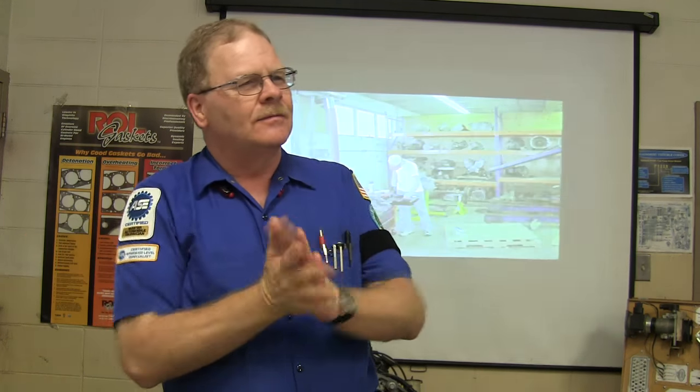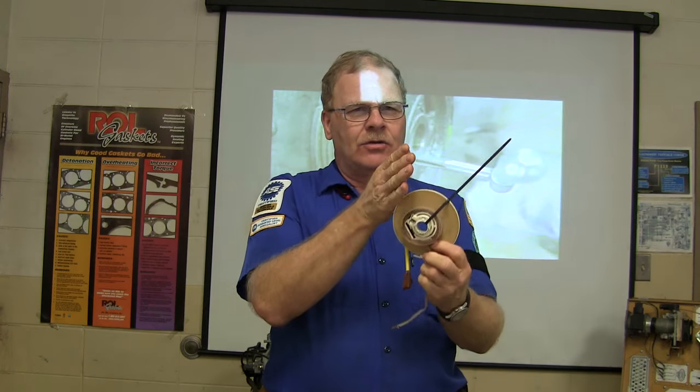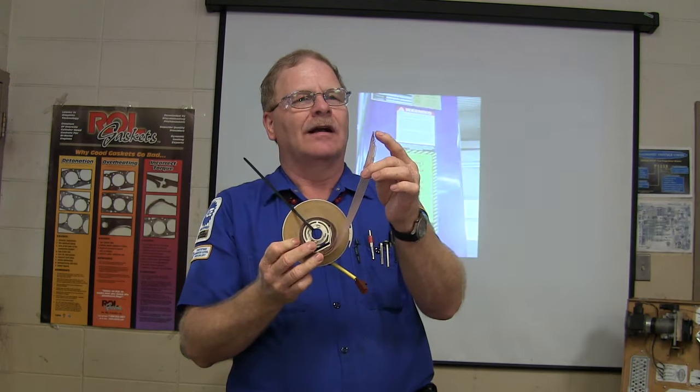Let's say you bring your vehicle in, maybe your own vehicle, and the rack and pinion is leaking. So you pull the rack and pinion off, and in the midst of all this, somehow or another, when you put it back on, the rack's all the way to one side or the other, or maybe the steering wheel's turned this way or another. Maybe you have to turn the wheels. When you put it back on, the rack is in the center, but the wheels return. That means the clock spring is wound all the way up, just as tight as you can wind it. But you've got to be able to turn the wheel both ways an equal number of turns, like 2 3/4 turns each way. And you turn it and it rips the doggone thing apart.